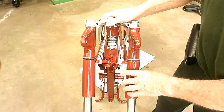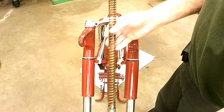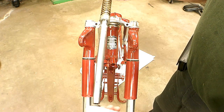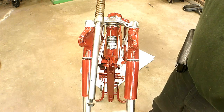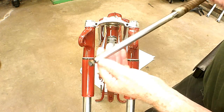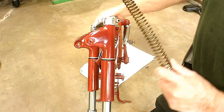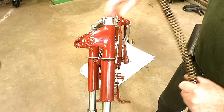The other thing I did which may interest people — I took this out of the inside of the fork leg so I could get it together, which lets all this drop way down. But you have to go in the bottom there and loosen this just enough so you can go in there with a — I used a little metal punch and hit the end of this screw, and that drives this taper out of there. Once that comes out you can lift this whole assembly out of the tube if this big nut is off there. So these have to come out — that makes it a lot easier when you get these out because then you're able to put these nuts in.